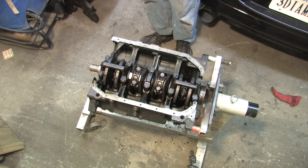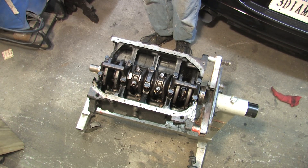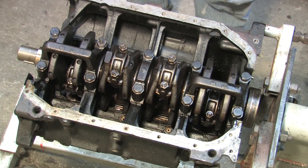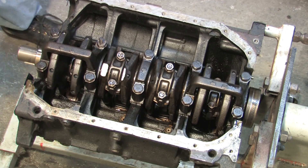Since this block is horribly varnished — actually it looks more like tar — it shows the owner didn't follow a timely maintenance schedule and may have even had EGR issues. This thing's stank nasty. I expect to find wide oil clearances and worn bearings in here, so that's what I'm going to look for first.